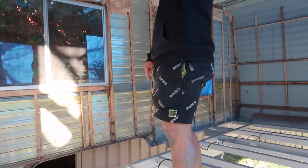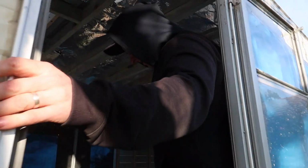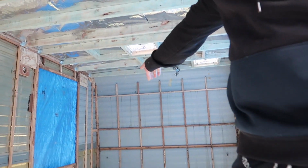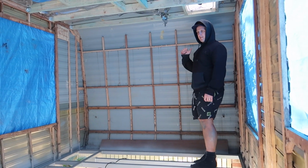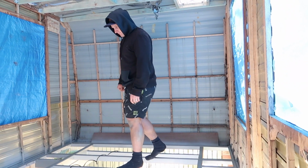It's 10 meters. It goes to the front of the drawbar. I've stuck it out like a meter past the front of the drawbar, roughly. I think it's long enough, because I wanted it to go to that corner, that back left tail light. For this tail light, I'll probably run 2-core wire to that. 3-core, anyway.